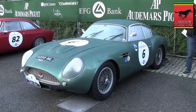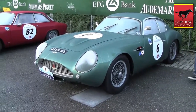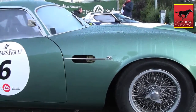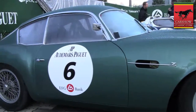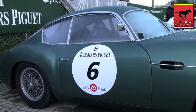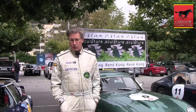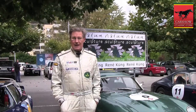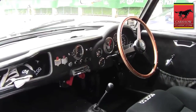Really what we do when we're driving a car in an event like this is go through two or three weeks of preparation. If you look at the seats, for example, in the DB4 GT they're wallowy — they're almost like a limousine — and so the first thing that we took out of course were the seats. We put proper racing seats in, proper harnesses, and then we just made sure that everything was crack checked, that the pads were new, that the rotors were not cracked, and that the fluid levels were fine. Beyond that there's really not a lot that we do with the car.